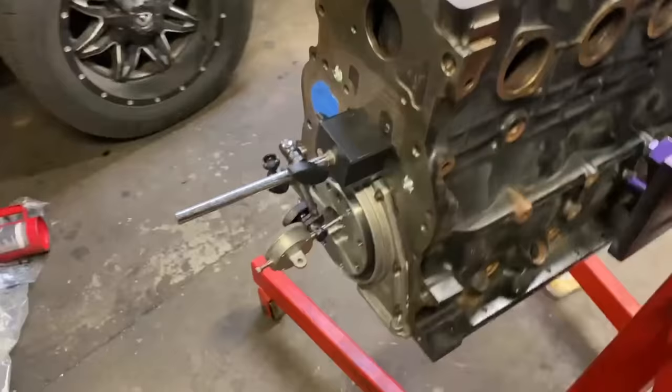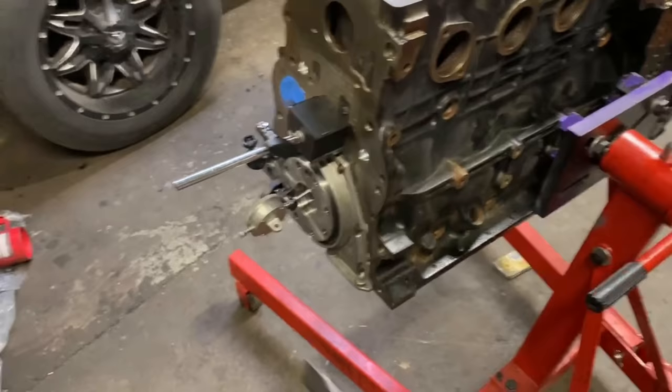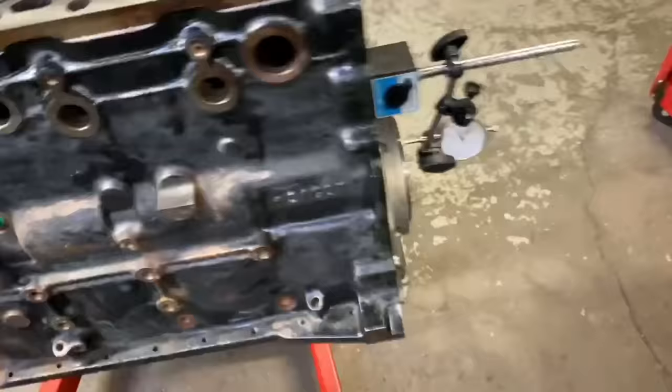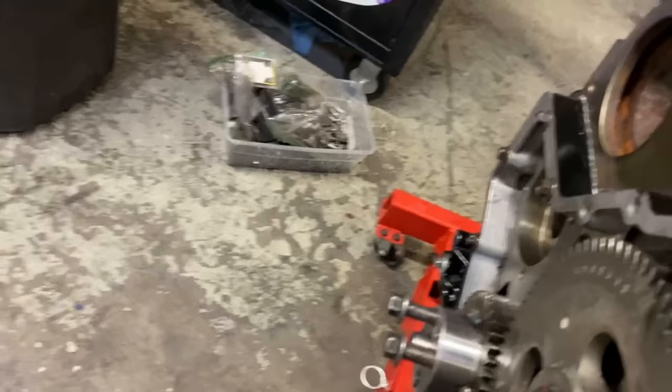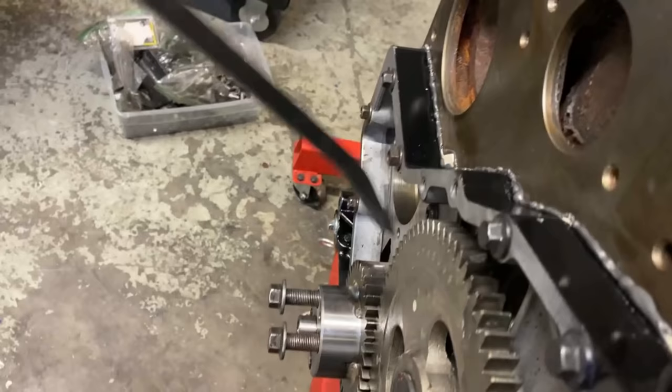Our last measurement here is going to be crank thrust. That's how much the crank can go forward and back against that thrust washer. So I got it set up a little different than I normally do it, hopefully to try and show you guys. But what I do is I pry on the front of the block right here against the teeth. So I will jam it all the way forward, like so,